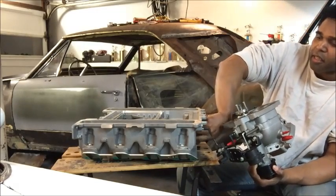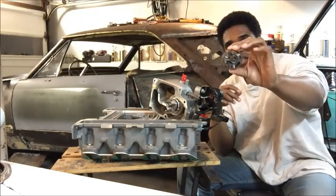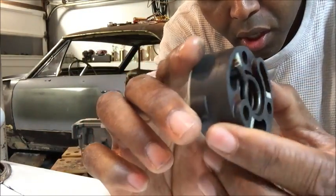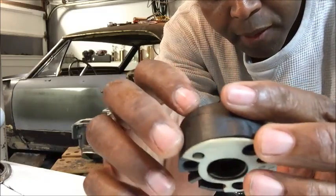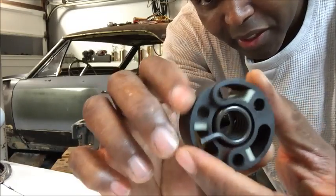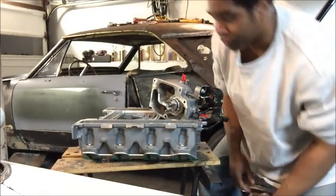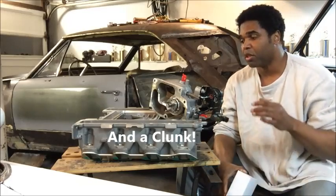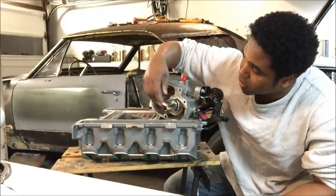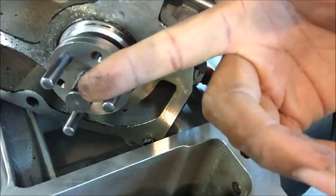What the spring-loaded isolator is, is this thing right here. This is the spring-loaded isolator that GM used. In theory it's kind of cool because when your car accelerates it doesn't put too much of a load on the supercharger, and when it decelerates it cushions it a bit. But people spending tens of thousands of dollars on a brand new car would hear a whine, and it also ruins this little part of the supercharger — you can even see this indentation right there, where the inside of the spring started eating away at this little shaft.